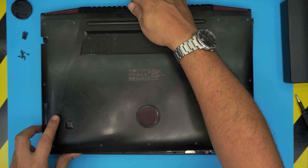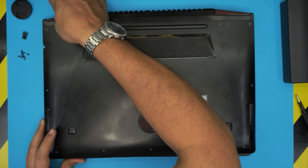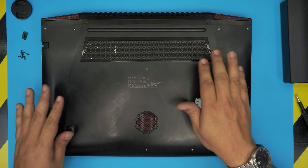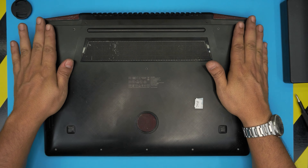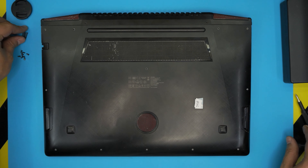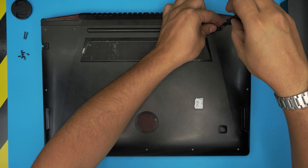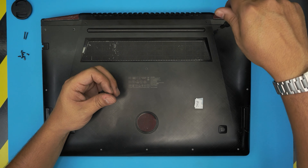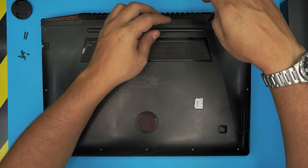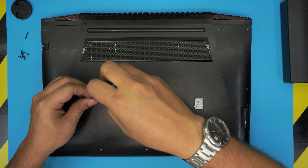These are 8 gig and 8 gig, so 16 gig total. If you try to insert the RAM the wrong way, the notch won't match and it simply won't go in. Make sure the notch on the RAM matches the DIMM slot, then bring it in at a 45-degree angle all the way toward the connector. Push it toward the connector first, then push it flat toward the motherboard — you should hear a soft click from the clips. Do the same for the second stick.